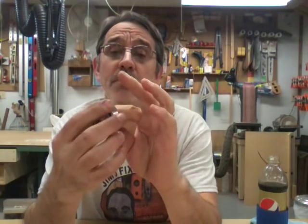Or you can buy these. This is a real bearing. It's not this sheet metal stamped. This is a more machine ground bearing. It's got ground balls in it. It has some side thrust, not a lot, but it'll hold up a lot longer than these will. And it's shielded just like a regular bearing. Now, these are $14 a piece. That's right. If you do your machine, you're going to have 60 bucks into the 4 front tires.